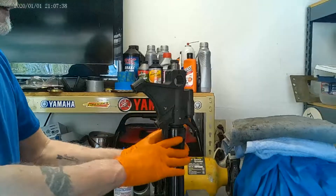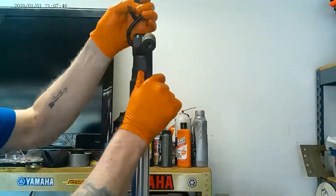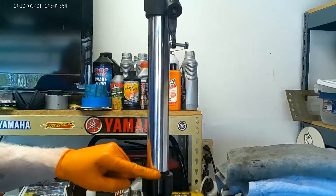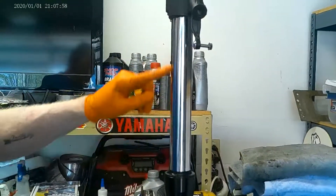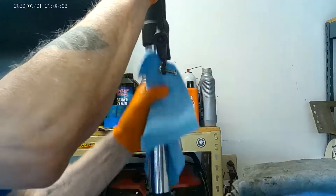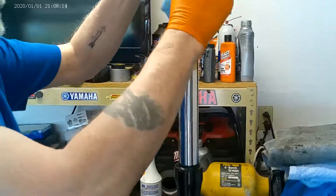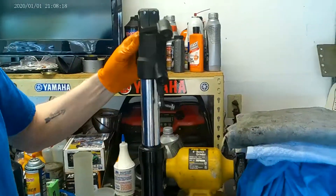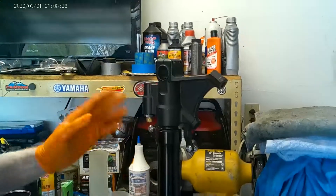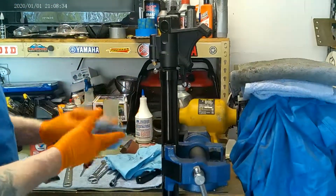So I've got the new seal in, got everything in place. I'm going to pump this up a few times, and then I'm going to clean the grease off. The reason I put less grease on my dust seal than my oil seal is because whatever grease I put on here could eventually end up on my leg as it wears away. So I'm going to clean this off, and that minimizes any grease rings that are going to be left. That's why I cycled it a bunch. But if you do have a freshly rebuilt fork job and you see some grease rings, don't worry about it — that's actually a good thing. That means the guy greased your bushings and seals when he put them back together. Just wipe it off, and within a couple hundred miles of use, that grease will stop showing up.